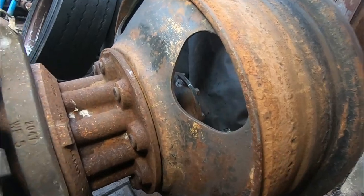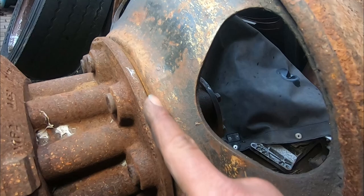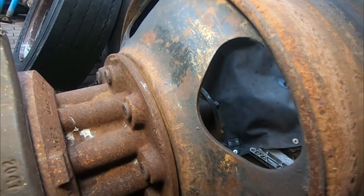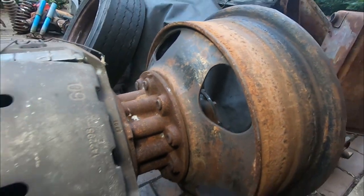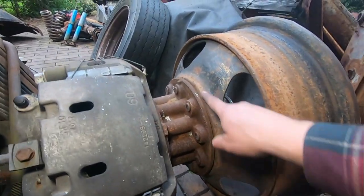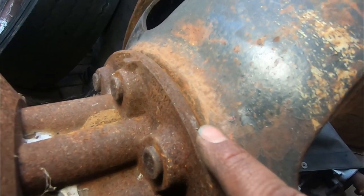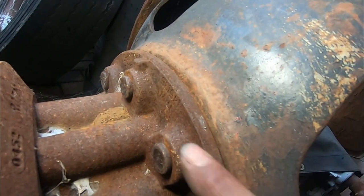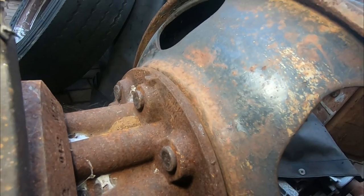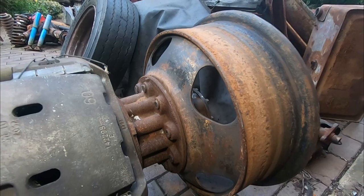So whilst we've got ourselves a perfect fit on the studs and center bore, unfortunately our hub along here is a little bit large in order to fit the inner band of the wheel. This is also the same problem up front. So we have got engineer's approval to machine this part down pretty much right to where that stud sits. But that'll be in an upcoming video. In the meantime, let's get these other seven rims sorted.